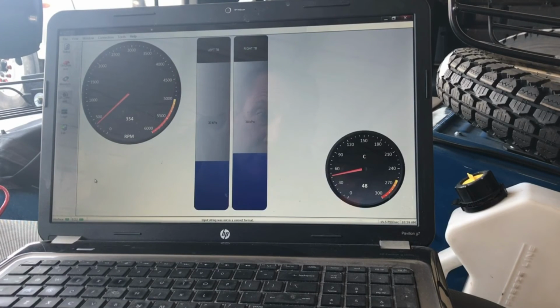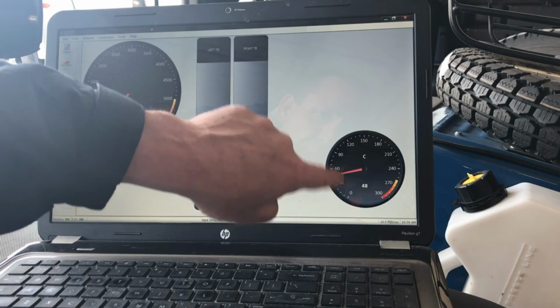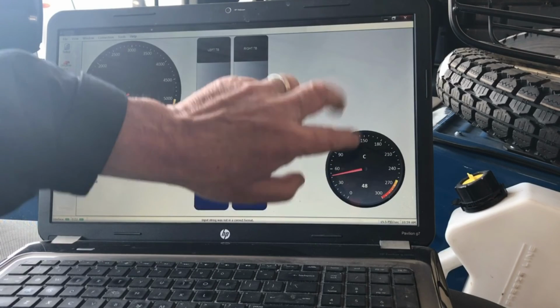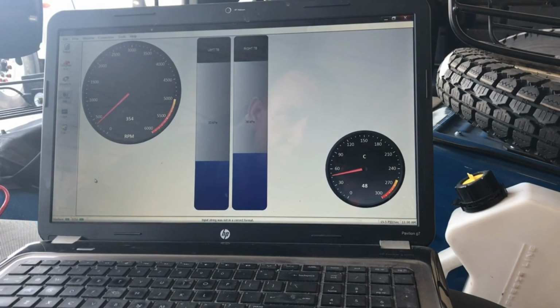Again, huge shout out to Masshole Engineering for all his help on this, and we'll continue to look at it. One of the things I'm working with him on is I'm not exactly sure what throttle body it's pulling the temp off, but we've got to figure out a way where you can get 2 temperature gauges up there and see where it's pulling it from, because there's 2 different sensors, one in each head. But this is a good enough indication of the cylinder head temperature.